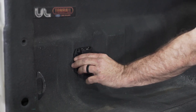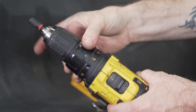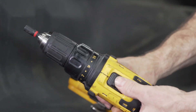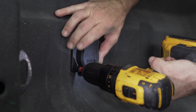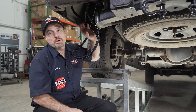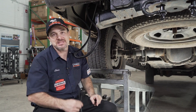Mount it to the truck bed with the provided self-tapping screws. Lower the torque setting on your drill — too much torque will cause the self-tapping screw to over-widen the hole and it will not secure properly. Now mount it to the truck bed with a quarter-inch socket. Then find some existing electrical wiring in the bumper and secure our wire harness to it with the provided zip ties.